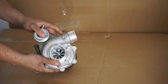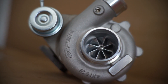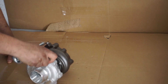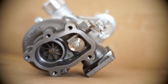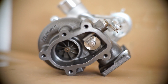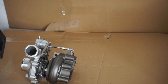As you can see here, you still have a billet compressor wheel which is 9-blade, basically the same as the GTX Gen 2 or the G-Series from Garrett. So the aerodynamics of this turbo are pretty good. You also have a 9-blade turbine, which is kind of where the magic happens. The housing AR is 0.55, which is not that small or that big either. The popular housing options on the GT28s were 0.64, which would be around that size.